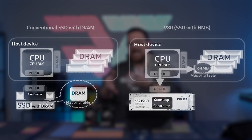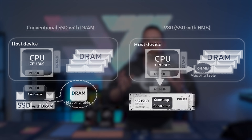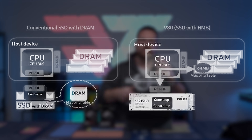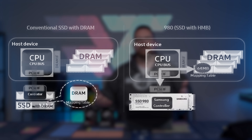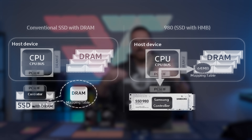The second thing I want to talk about in terms of NVMe technology is DRAM versus HMB, or host memory buffer. With DRAM, there's actually DRAM on the chip, which the chip uses for caching writing, caching reading, and putting a map of the overall memory. But there's this relatively new thing called HMB, or host memory buffer — using PCIe, it allows you to use the RAM from your system to do a lot of those same things. Though not as efficient, it's still pretty fast given how fast PCIe is. As you see things like PCIe Gen 4, DRAM-less NVMe SSDs like the 980 will start to catch up with the 970 Evo Plus and 980 Pro as costs for flash go down.